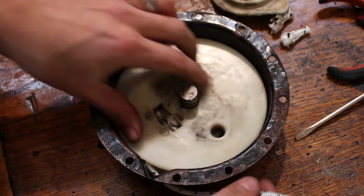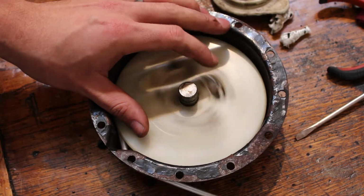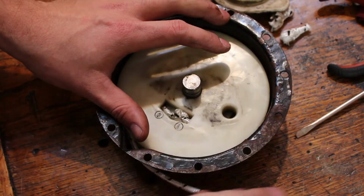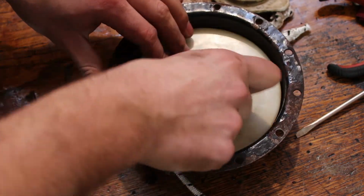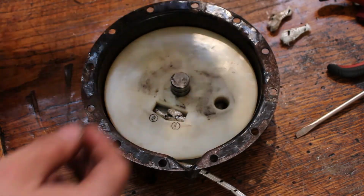Yeah. So once you have it wound up, all you really have to do is just pop it down in there, and since, like I said, that spring is retained and under tension, when you pull on the rope, the spring just rewinds it. Which is kind of like the opposite of a pull start on a lawnmower, at least the ones that I've worked with. You always have to mess around with the springs quite a bit once you get them back in, but this should be good.